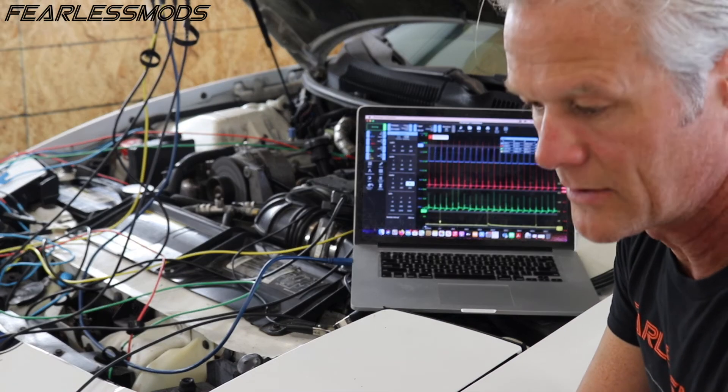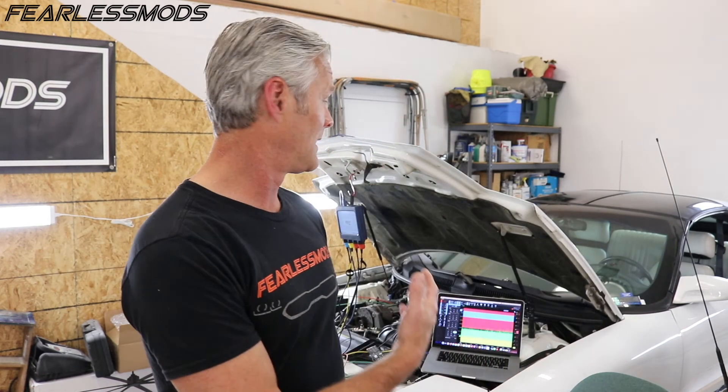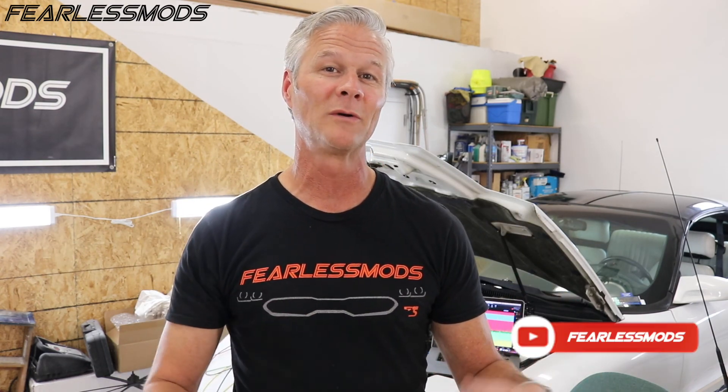This clearly looks like something in the secondary. So there you have it — we've replaced the coil and it has improved our position on how this is running, but we still have an issue in the secondary. The next thing we're going to do is get into the opti spark, check those signals, make sure we're solid there. After that, if that checks out or points to something, we'll likely be digging into the opti spark. That's going to be a wrap for this episode. I hope you enjoyed digging into the coil and a bit of the PicoScope diagnostics of the ignition system. Keep watching to see how this turns out — thanks for watching, please like and subscribe, we'll catch you again real soon.